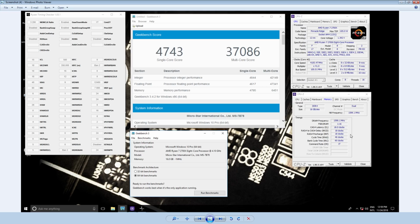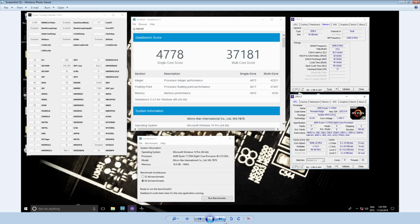And so that was just a catastrophe in terms of memory overclocking, and that's why we're only doing high-frequency loose timings here. Ultimately, where the kit maxes out is 3400 megahertz, 18, 40, right? So if you look at it from the perspective that it's a 2400 CL15 spec memory kit and it overclocks by almost 50%, that sounds pretty good on paper. But the performance really doesn't make up for it, because with a lot of things like TRCDWR on E-die and B-die, on good kits of B-die and E-die, you should be able to set that timing all the way to 8.